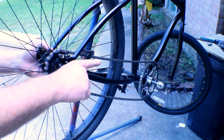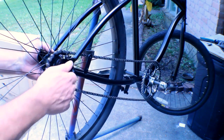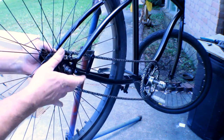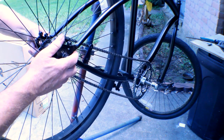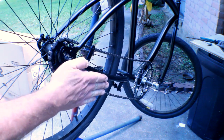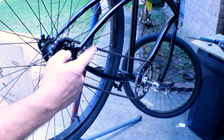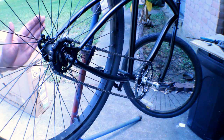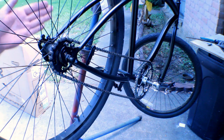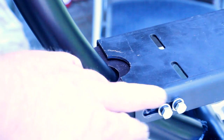Now we're ready to see what sort of clearance issues we have to deal with on getting the motor mount set up in the right position. Let's tighten this up by hand — just tight enough to hold it. You want to get your rear wheel centered, then get it good and tight by hand. Now let's take a look at the motor mount and what we need to work with, taking into consideration where our rear sprocket is going to be because we need a straight line all the way up from the output of the transmission.